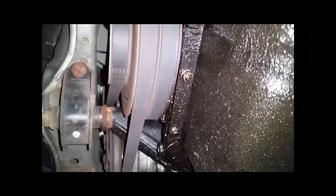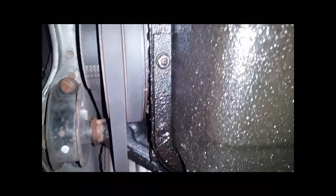The shield moves out a little bit so I can get to these bolts. When I pull the oil pan down I'm going to use some Scotch-Brite or a fine wire brush aluminum attachment for my little air rotary tool to clean up the mating surface so the new gasket seals properly.